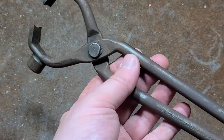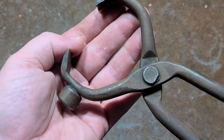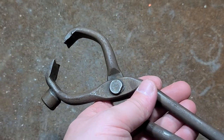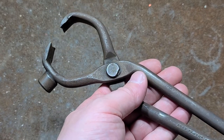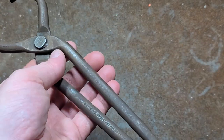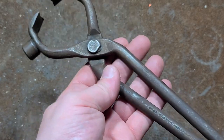But it's just kind of nice to have a dedicated tool that's just for dealing with those dust caps, being able to grip them nice and securely and then just work them back and forth to finally get them off in a more controlled fashion — and less fiddling around using a pry bar. Sometimes you use a straight pry bar way off on the edge of the wheel. With something like this you can just grab a hold of it, get a nice secure grip, and then just work it off.